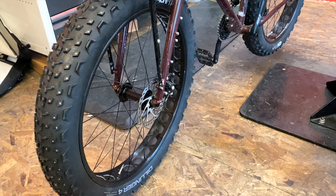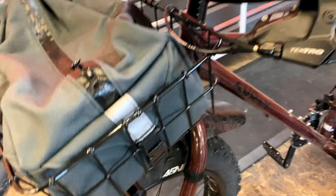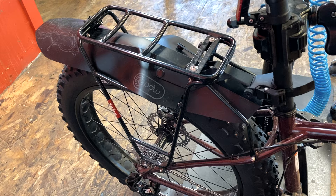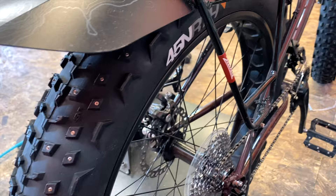New Surly bar — a little bit more aggressive and leaned over. New Ergon grips so I'm not slipping off. And then fenders: this is just a little guy on the front, the mud shovel from PDW, installed with velcro. Here's the rear fender — I had to accommodate for my rack so I cut out a little triangle right there. Nice easy fender installation, no tools required. And here's the rear tire in that reverse setting — nice paddle here to push it forward. Replaceable studs, and we're gonna go try them out. That's my fat bike ready for the season here in Colorado.